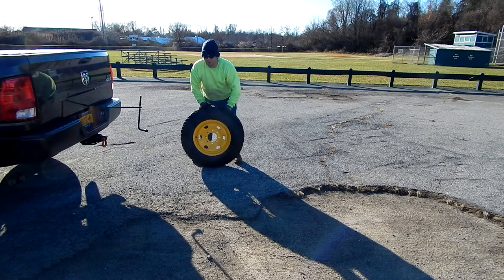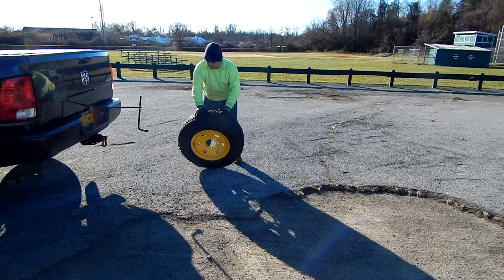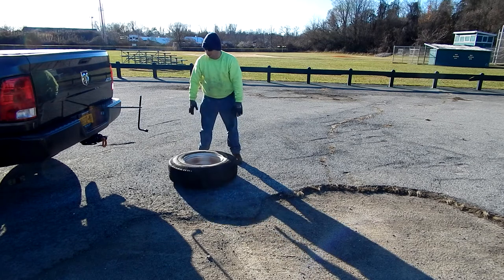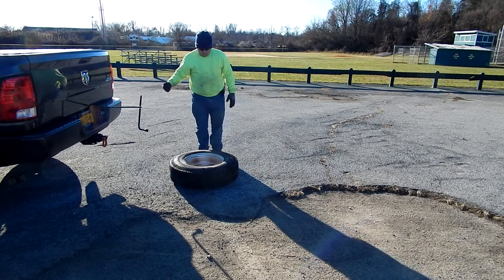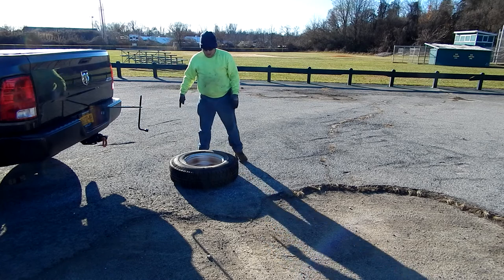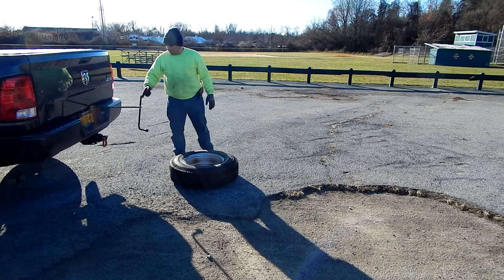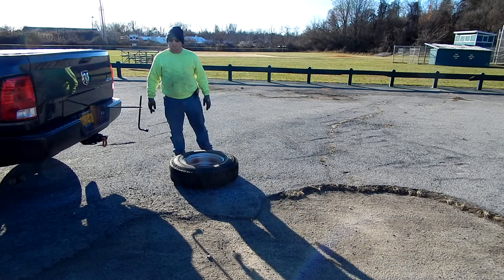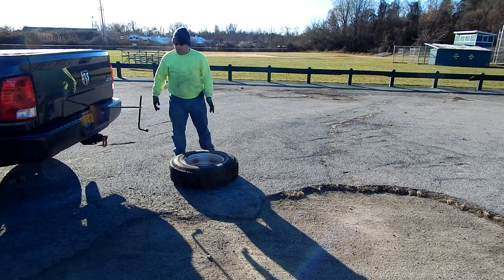On this particular truck, the tire goes face down. If you're antsy about protecting the finish, you can lay a piece of cardboard — I didn't have one, but that's why I don't waste powder coating on spare tires, just a little paint. I have a backup camera, so I'll back the truck up just enough so the edge of the rim aligns with the bumper and I should be right over the tire — and that's how I do it without having to slide the tire and kill my back.